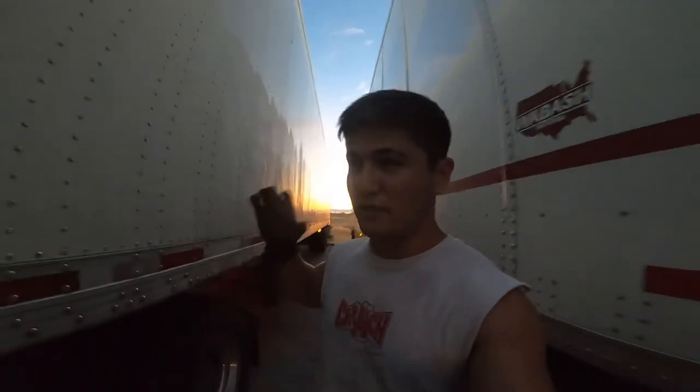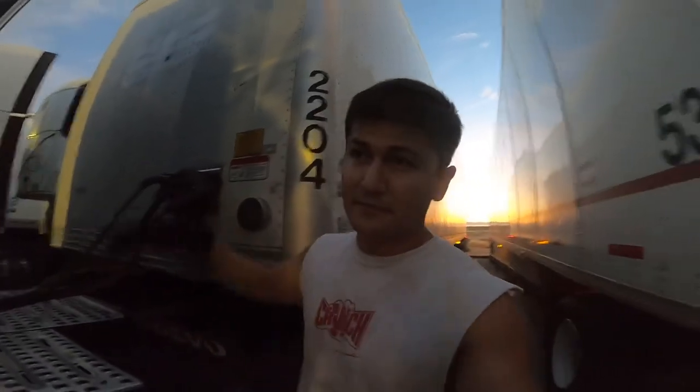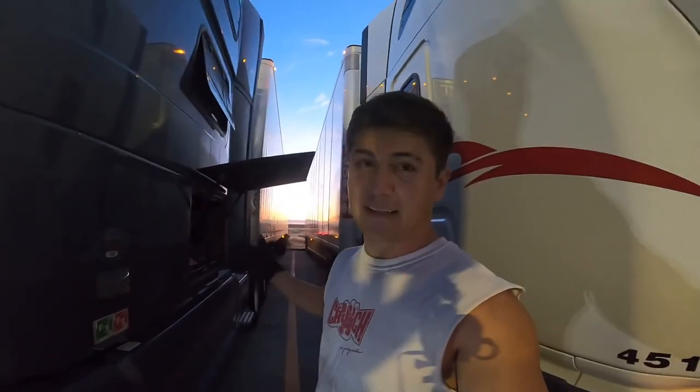Let me repeat it one more time. First, turn on your emergency signals and make sure you're getting lights all the way to the back of the truck. If all the lights are working, your lamps are not burnt and you're getting electricity — so no wiring issue. It could be a short circuit or poor ground, but before you do all of that, go check the fuses. In a scenario like this we were able to analyze and fix it in less than three minutes. Thanks for watching — hopefully you found the video useful. Please share, comment, subscribe, and until next time — peace.